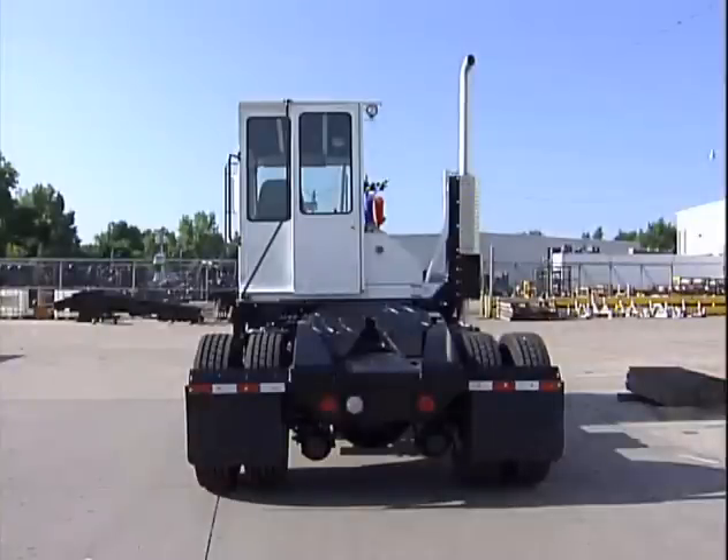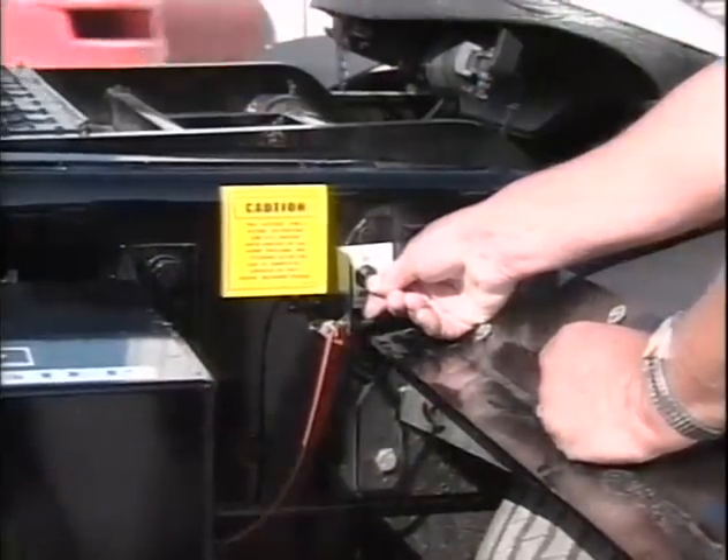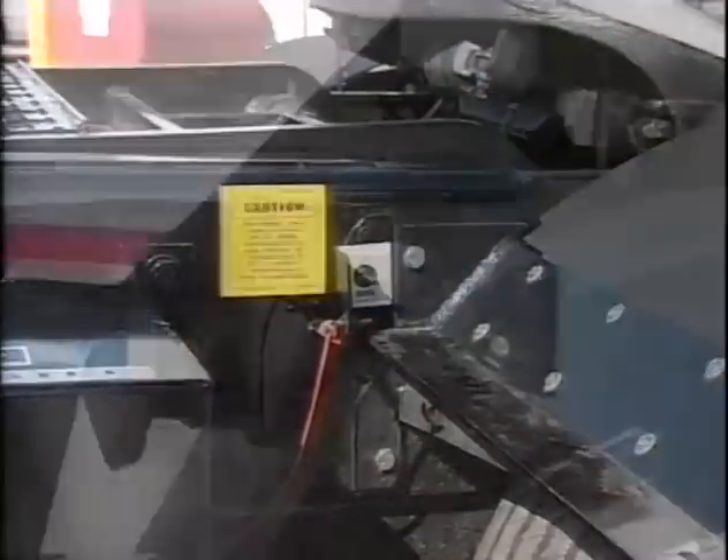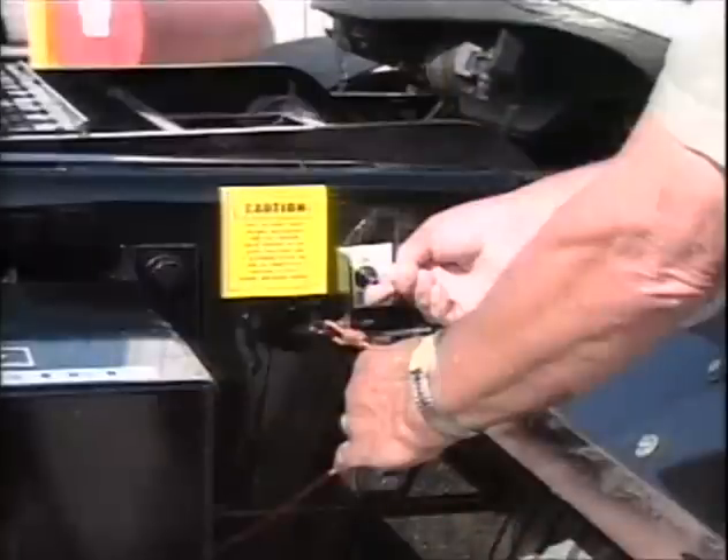Now that you're at the rear of the cab, look under the deck to be sure the cab is locked down. To double check, depress the cab tilt switch momentarily to the down position. Also look under the cab near the steering box to see that the cab lock bar is all the way down. With the safety guard in the proper down position, the cab is prevented from accidentally tilting. There is also a warning label with the cab tilt instructions located on the frame by the cab tilt switch. Remember, keep clear of the cab when raising or lowering.